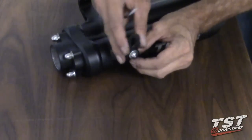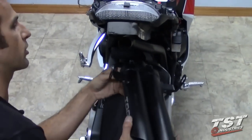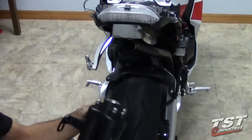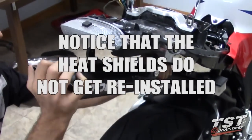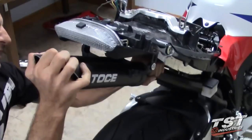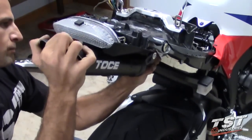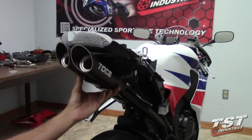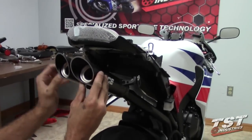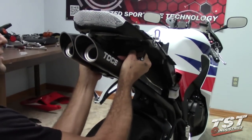The idea is just to get it a little snug, not tighten it all the way — you want to preserve some adjustability for now and tighten it up when everything's aligned on the bike. Do the same thing on the other side. Once again, you want to preserve adjustability here. We can now take it over to the bike and start to fit the canister onto the mid-pipe. These exhausts provide a decently tight fit, so you're going to need to wiggle it around until you get it to bottom out. The exhaust is not hanging level, so we're going to twist it to make it line up with the lines of the bike.